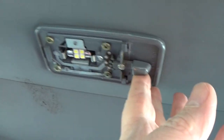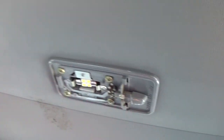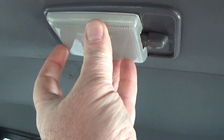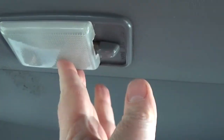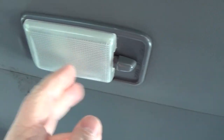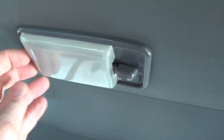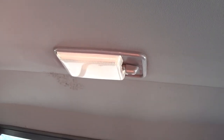It's pretty bright so it's gonna probably blind you. I put it in the off position, plug it in all the way, then turn it on — you can see how bright it is. The last thing is just to put the cover back on. Put the single tab to the back first — actually it's the front tab first — then push the back in and that's how you get the lens back on. This tool also helps in taking the bulb out so you don't break the glass. Anyway, hopefully this will help somebody out there — thank you for watching.